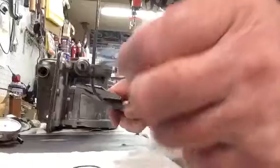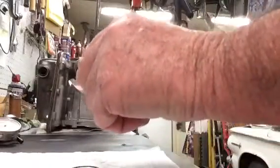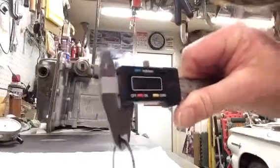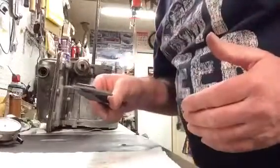These are our little spacers that go on that pinion gear spline — these are the spacers we need to measure to get our clearances correct. We zero out our gauge and measure: this first spacer is 30 thousandths. Our next spacer is also 30 thousandths — so we're at 60. Then measuring this last spacer — that one's about 15 thousandths. So we're at about 75 thousandths. These spacers put us at about 75 thousandths, and we needed from 64 to 80 thousandths, so that should put us right in the ballpark.